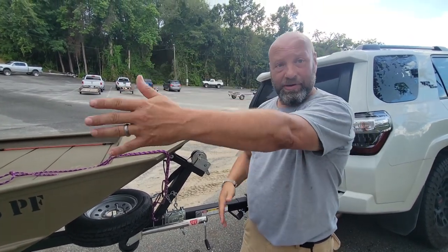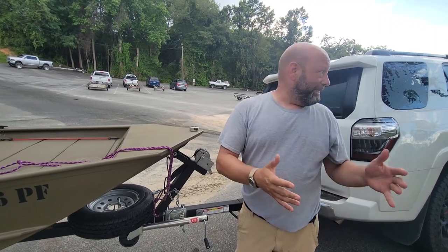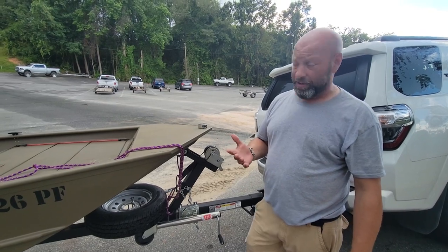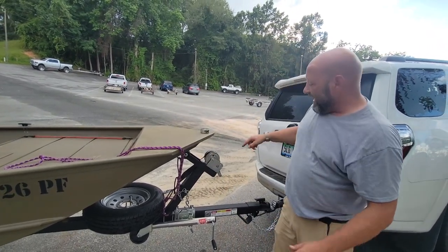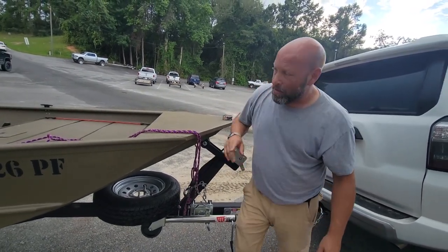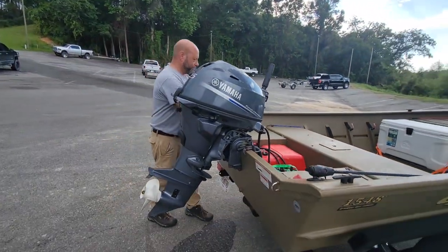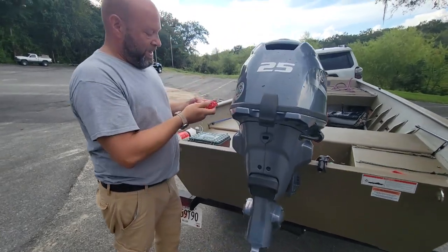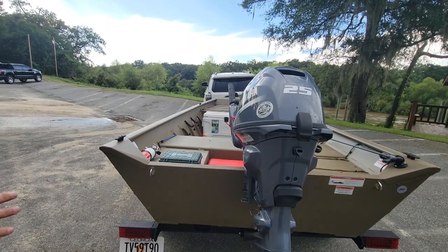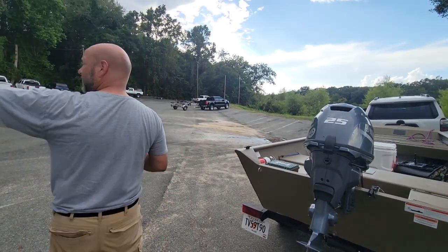The rope is going to feed away from the trailer. Once the slack is taken up, I put the truck in drive, pull slightly, and it's going to bring the boat up to shore for me. Then I can get out, grab it, pull it into shore by myself, tie it off, and go park my truck. Double check everything: make sure the winch is locked, rope tied on the boat and to the winch, plug in, rear straps unhooked, motor in the up position, and key in the motor. We're doing all of this at the parking lot, not down at the ramp blocking it.